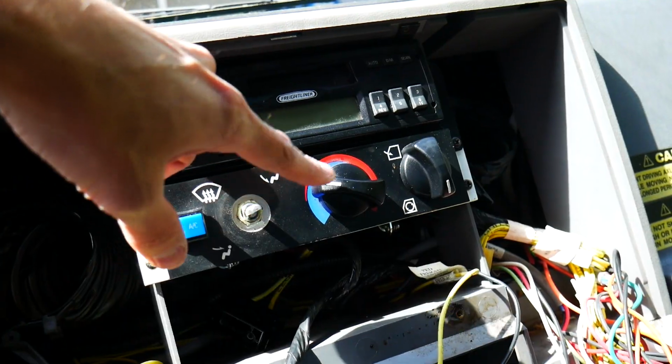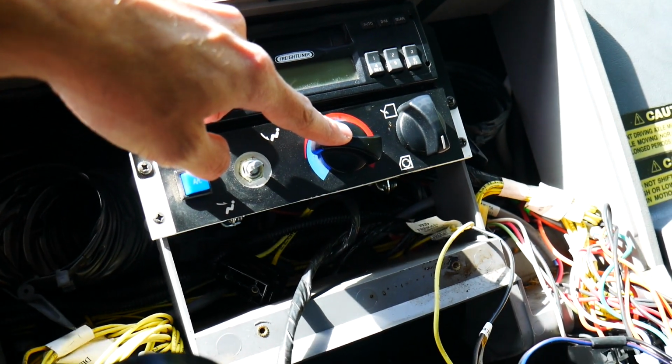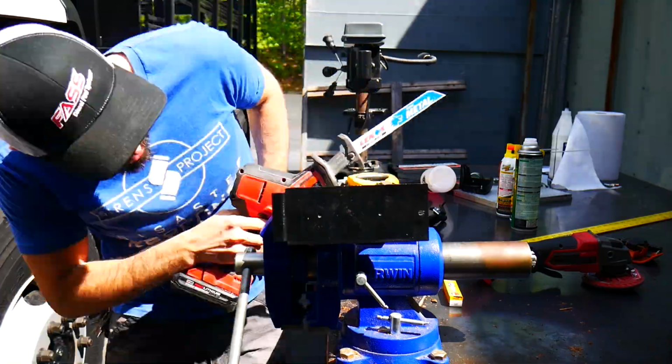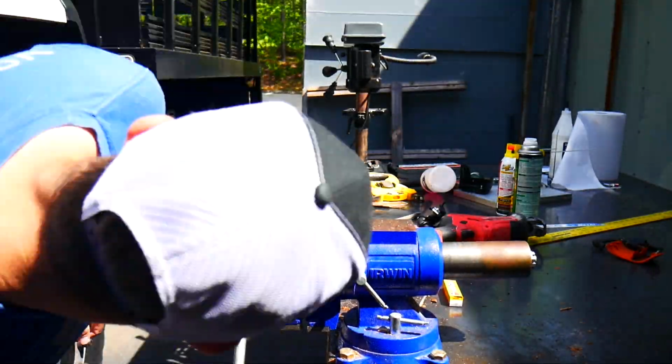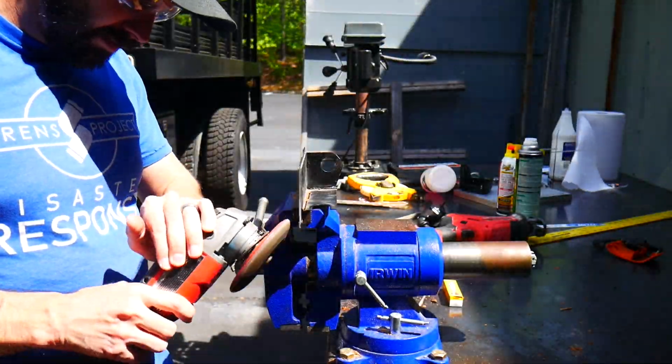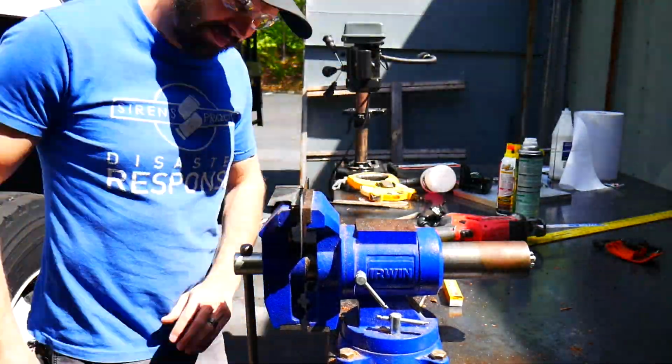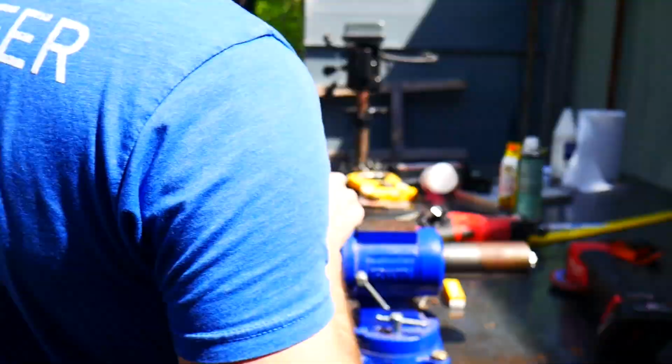We've done the heater valve. We had to replace that and free all the cables. We have 3 climate control cables from the cab to the engine bay, and basically those were frozen from the truck sitting a little while. This truck only has 7,800 miles for a 2003, so that does come with some consequences for a truck sitting for a little while. So the cables were frozen.